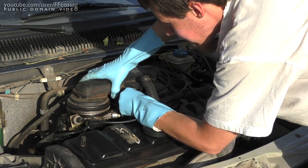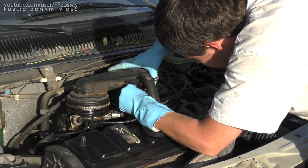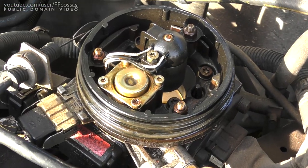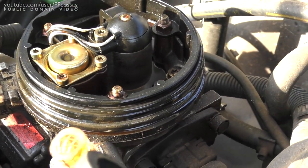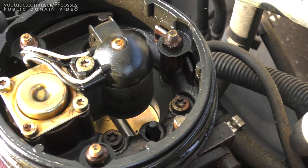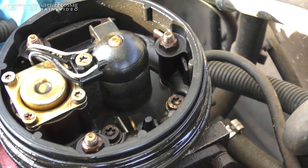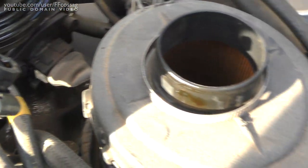Let's see if we can get this off again - and we're in! The injector assembly does look rather clean; it has a tendency to grease these O-rings up on its own, which is fine. The butterfly valve looks excellent. This whole thing is pretty much factory standard and it seems to be in decent working order - nothing wrong there at all. And we do have an air filter - let us inspect its condition.